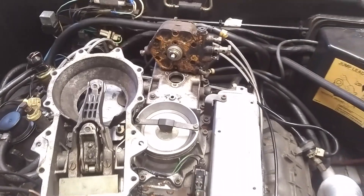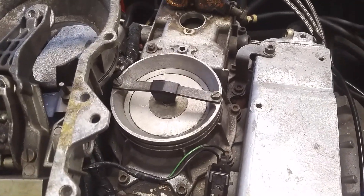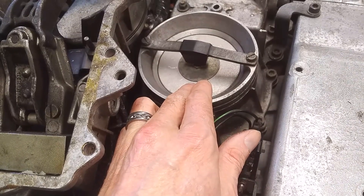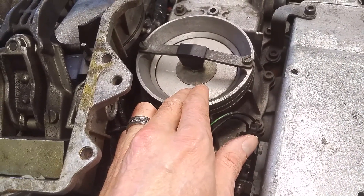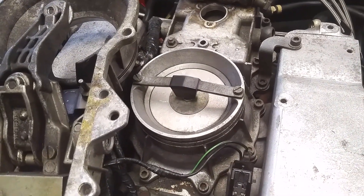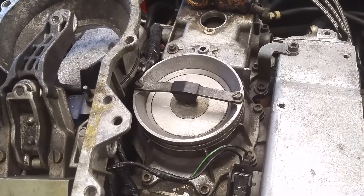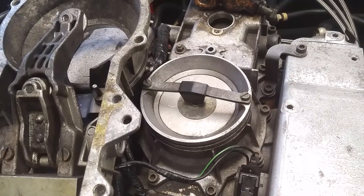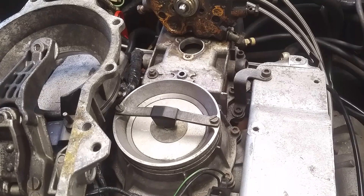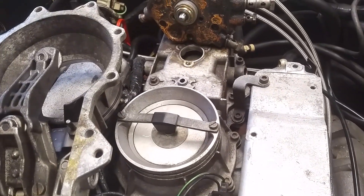I hope that was interesting. If you're building up an engine for the first time, what you need to do is pop the injectors out, run the fuel pump, and just check that when you move the flap down just a whisker the injectors just start to spray — that means you're in about the right place to start the engine. The fuel will be a little off when you first start it, but then you can finely tune it once it has caught. Other than that it's the usual with fuel pressures, and there's not a lot else to it — any questions, pop them in the comments. Cheers.